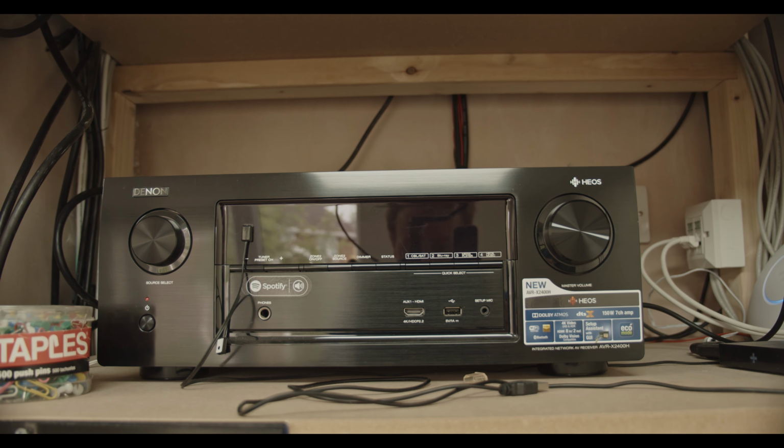You can see that I've got space for my laptop there, which has some cabling. As well as Cat 6 cabling, you can see here I've actually got an SFP+ port on the wall, and that's because I've got an SFP+ 10 gig link into my main PC, which I use for video editing. So I get pretty much a 10 gig link straight through to the data center, which is excellent.